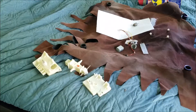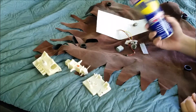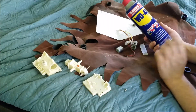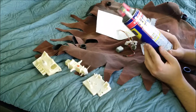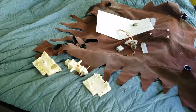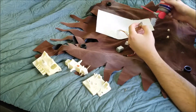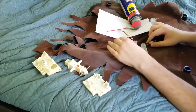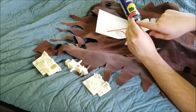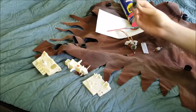Now that the brushes are clean, we're going to take our WD-40. If you're in an enclosed area, open up a window — I highly recommend you use this outside, because it's very strong and the scent it gives off is very bad. It even says not to use it inside; if you do, make sure it's in a very well-ventilated area. You're going to want to spray the end brushes right here — spray this back part of the motor and this part. You're also going to want to put a couple drops inside the motor part, through that hole in the center of the cage. You're also going to want to spray a little bit of WD-40 where the brushes are.